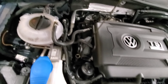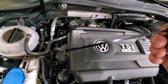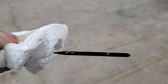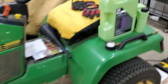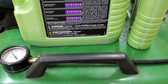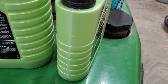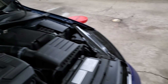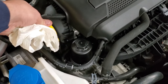Now we're going to check the oil level. I wiped the dipstick clean and re-dipped it — zooming in here for you — and it's right up to the full mark. So we are full. If you're doing this at home, leave yourself a little bit of oil. What I'll do later is put what's left into a smaller container to put on the shelf and take up less room.